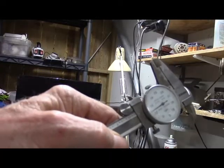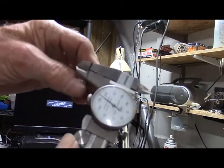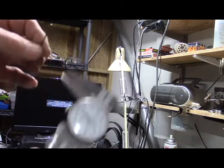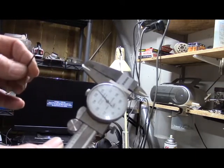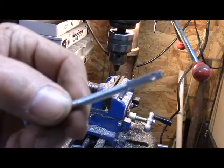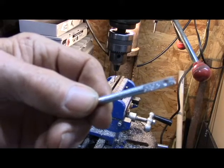Cable shows to be 25 thousandths. Got a drill bit here that's 55 thousandths, so that'll give it a little room to get it through there. I don't feel like threading a needle, so we're going to thread a bolt. Got the hole through there — let's get our cable through there so we can move on.